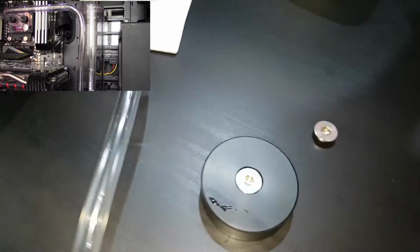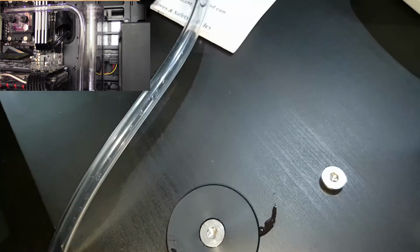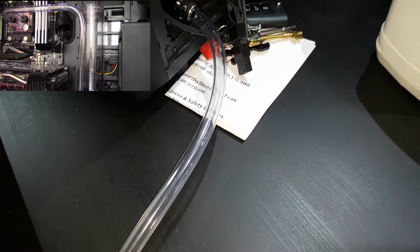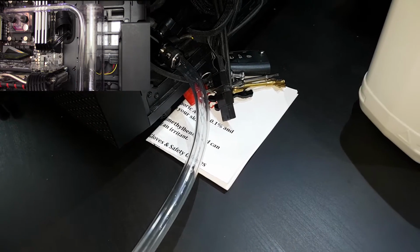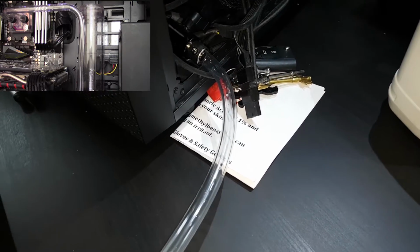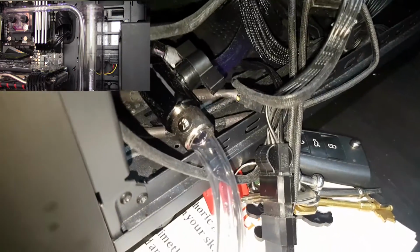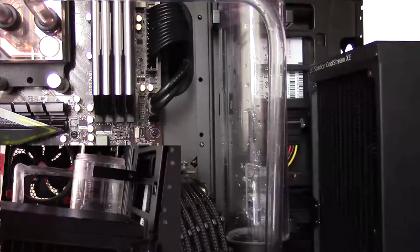Obviously it does help. What I'm going to do now is put another pipe on there, put that back on the radiator and blow into that, because that blows all what's left over the radiators back into there. And a good practice is to rinse it out with deionized water, just to get rid of all the coolant before you put the Blitz Part 2 in. So yeah, I'll be back once I've rinsed it out and I'm ready for the Blitz.